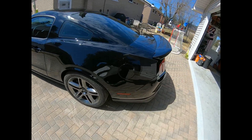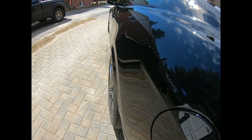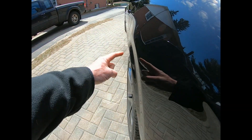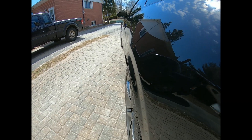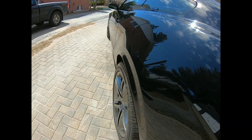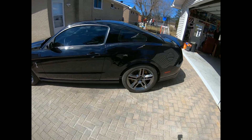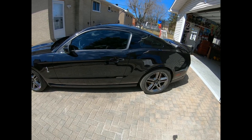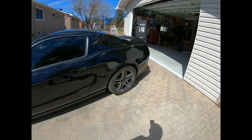Well, the only way you could do it is if you give the rear fenders a little bit of a roll. You can see right here, flared out the fenders — we ended up flaring each side about five-eighths of an inch. So that gave me enough clearance to run those big tires. I'm going to take these stock wheels off and show you what I had to do to the inner fender.